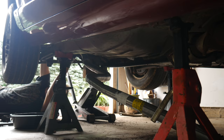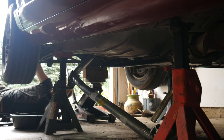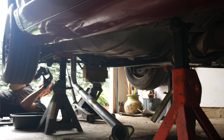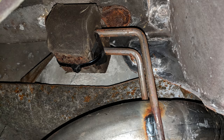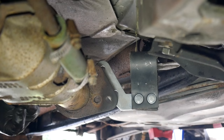Now we'll feed that new exhaust pipe under the car and finagle it over the top of the rear axle. Since the car was already in the right position and we kind of sort of remembered how we got the other pipe off, it didn't take long to get this one into place. For the rear of the intermediate pipe we're just going to reuse the old exhaust hanger. The rubber appears to be in decent shape and it has a steel clamshell housing so even if the rubber failed it wouldn't fall apart. The old exhaust pipe had a stamped steel hanger that fit much tighter — the new one just uses a piece of bent steel rod which fits a bit loosely. So we just stuck a piece of rubber in there and zip tied it in. If we ever notice the exhaust is a little bit loose, that's probably the culprit.